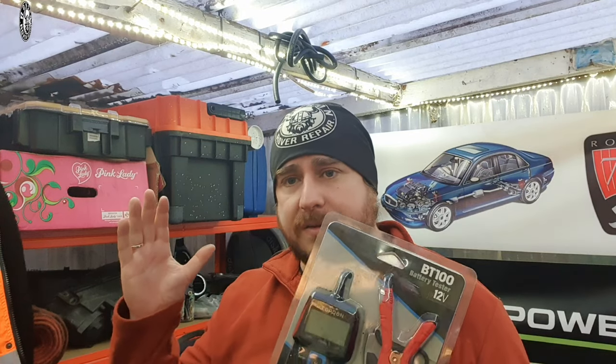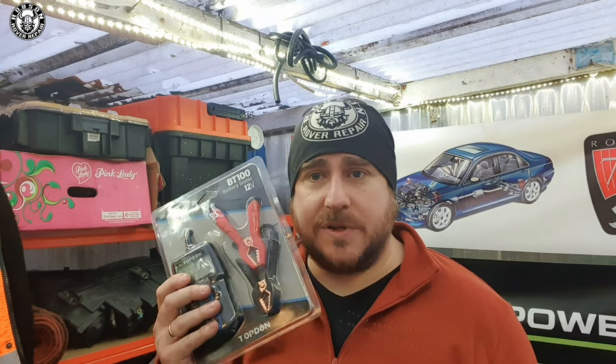Before we got it down to Mark, I had busted out the multimeter and I was checking a few things. I was getting pretty inconsistent readings — there were times the battery was fully charged at 14.4 volts at idle, and times it was dropping to 11.2, which made me think maybe it's not the alternator, maybe it's the battery. I didn't want to spend money unnecessarily. I remembered I had this sitting here, plugged it onto the battery, tested it, and because it has the ability to recognize multiple batteries of multiple manufacturers and give you a full health diagnostic, I was able to know instantly it wasn't the battery. Sure enough, Mark swapped the alternator and this saved me an unnecessary expense.